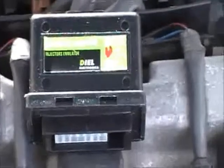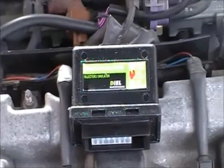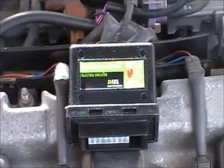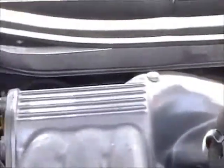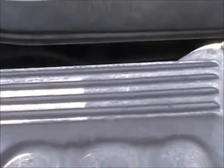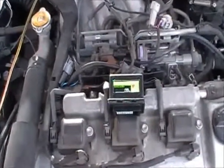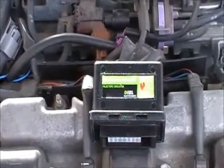This little module you see here is the emulator module — really it's just a little box of relays that turn the gasoline fuel injectors on and off. It's actually mounted right back behind the intake manifold but it's just back in there too tight to see. When the CNG switch is on, the relays open and disconnect your gasoline fuel injectors.